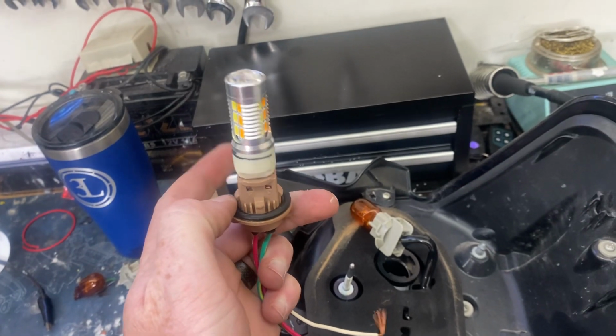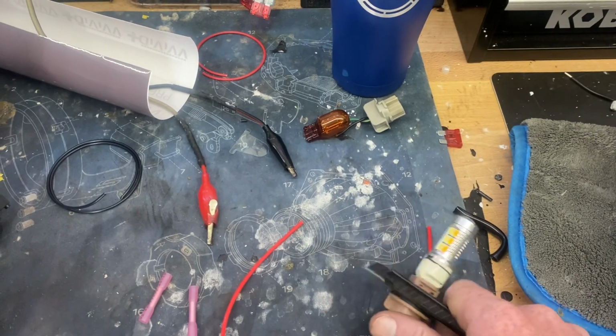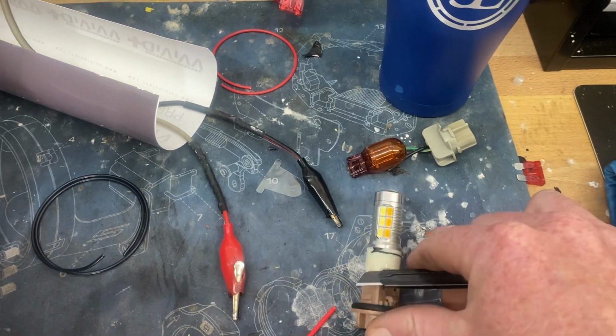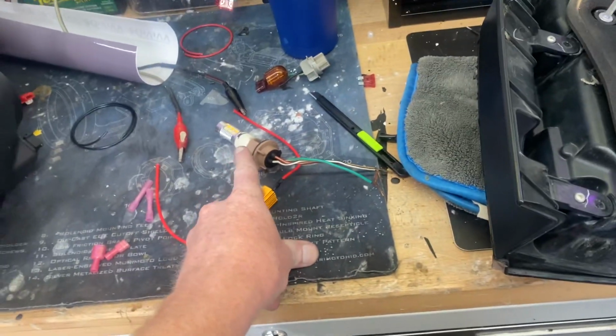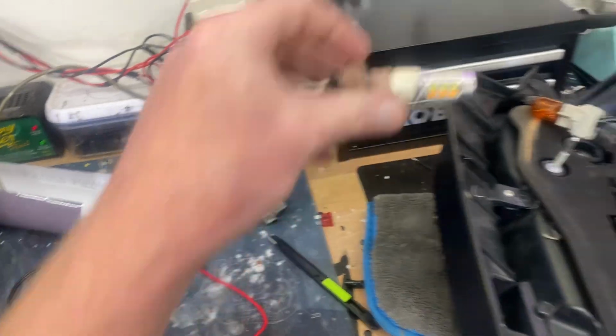Now these side pieces here, the fat parts, are a little bit fat to fit in this plug. So what I find really easy to do is just play with it and take a little razor blade like this and shave the sides of these plugs. Shave, shave, shave until it fits. Another thing I like to do, because I off-road a lot, and you can see there's already some remnants on this particular bulb, is I put one layer of electrical tape between the bulb and the socket. Especially with aftermarket bulbs, the vibration tends to shake these real long bulbs, and eventually they can come loose. So I like to secure them with one little strip of electrical tape, and it usually fits just fine in there.